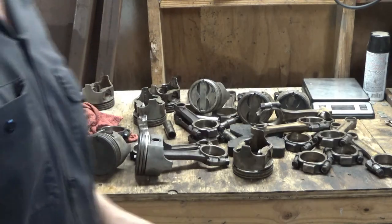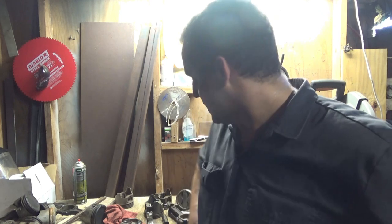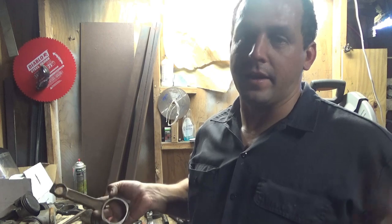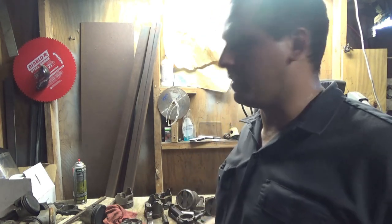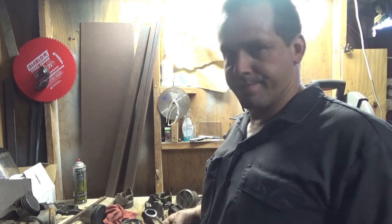And you see, if you took that to a machine shop, that's not really practical because they're going to charge you per piston to go search through that — and if you told them to find a rod that weighs the same, they're not even going to want to deal with that. When I got all these pressed off, I told the guys to give me back all my parts so I could weigh them and evaluate whether or not I want to get it balanced. If all the replacement parts weigh the same, I'm not going to balance it. But they threw all my parts away except for my rods. I mean, it was junk, but I wanted to weigh it though. They did give me two back as examples.